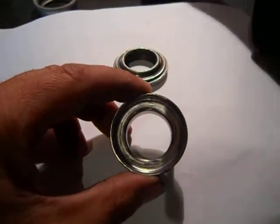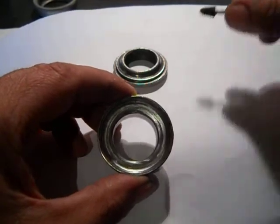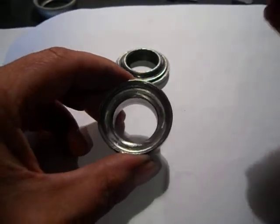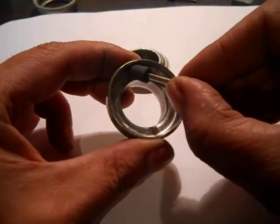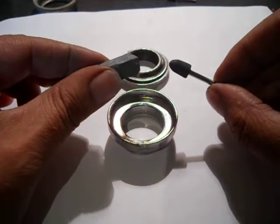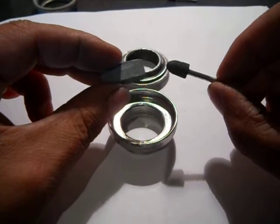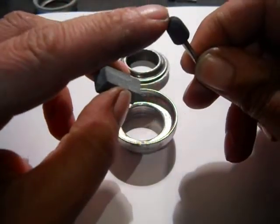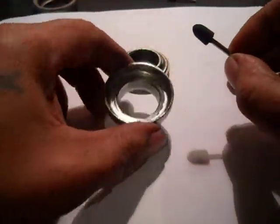What I do is I use these emery stones. I have one that was rounded — more rounded. Now get down in there. You can change the shape with your stone. These stones come with your kits. If you get a bunch of brass or garbage in your stone, you can clean it out. You can shape it, but you've got to be aware that once that metal starts showing in the tip, that's what's bad about it. You're about done with using it for this.